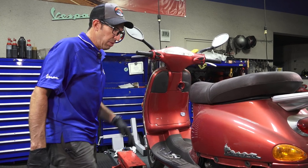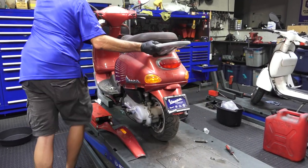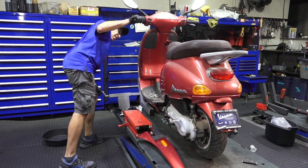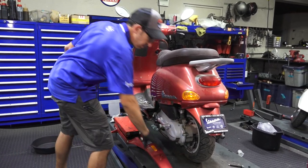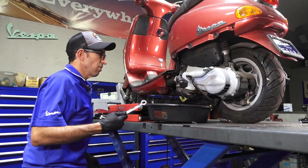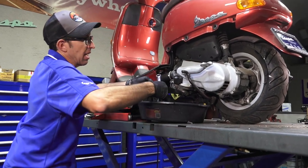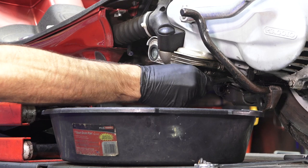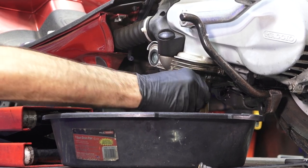We're going to drop the oil and see what comes out. As with many Vespas, you've got to take it off the center stand. You can watch my prior video on how to support a Vespa without a motorcycle lift using a homemade stand and a scissor lift style jack stand. So I got the tires supported and I'm going to go ahead and raise the scooter. I left this skirt off for a reason. All the newer motors drain oil from the right side with a 24mm wrench. These older ones have a little brass drain bolt that takes a 17mm wrench and comes out of the oil pan. This motor was last produced around 1999 — pretty short-lived.